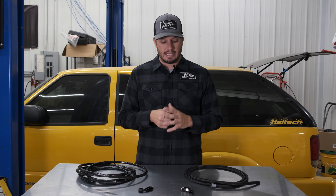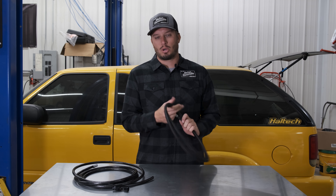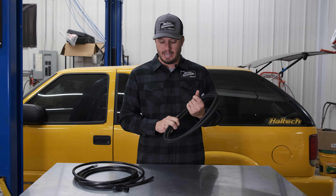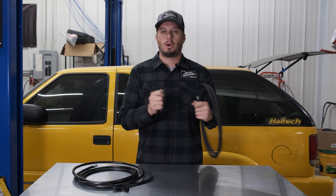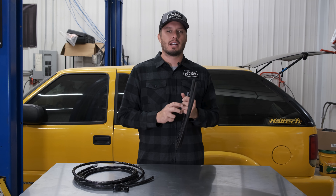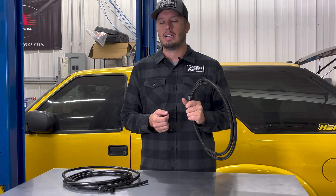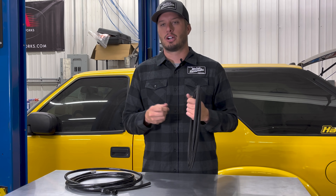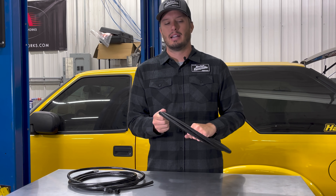I want to dig a little deeper and give you the quick ins and outs of it. One neat thing I like about this nylon rubber core style hose is that because it's not solid stainless braided like PTFE, it's going to reverberate noise a lot less throughout the length of the vehicle. Anytime you have solid stainless braiding, it carries the noise of the fuel pump or any other vibrations up and back through the vehicle. If it's mounted on sheet metal or your frame, you're going to hear that a lot more than with the nylon style. This stuff is super quiet and it's lightweight.